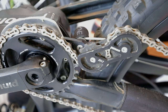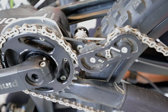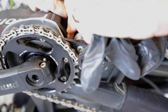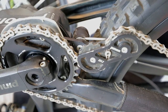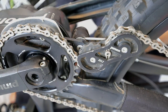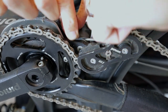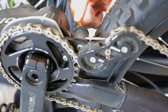Pro tip for Zeroed bike owners or anyone riding a Pinion gearbox: under here is the tensioner spring. If you're riding off road, these springs get dusty and dirty and make a horrible squeaking sound. Put your favourite oil on the spring when it's clean. Then — this is from a Lezyne CO2 canister refill — you buy a pair of CO2 canisters and you'll get a little sock. Cut the sock to length, then get fingers from a rubber glove, cut them to length, and throw them over the top. I'll use two for double protection — just pop them over like a tensioner spring condom. That'll keep the oil in and the dust out and will last about six months. Keeps the dust out, keeps the oil in, stops this from squeaking.